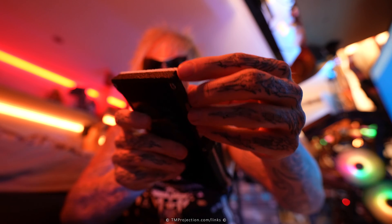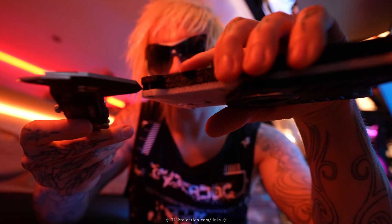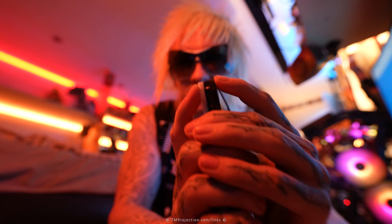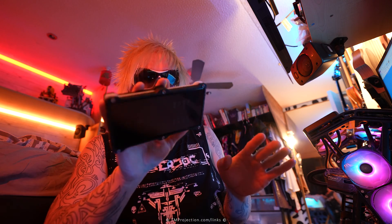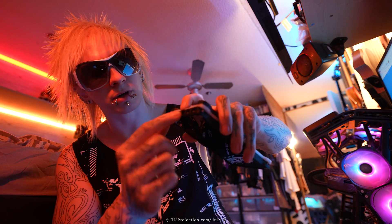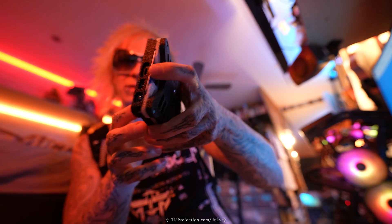The design is much stronger now because we have the corners right-angled — they are square now, 90 degrees. They're not rounded off anymore. In version one they were rounded off. I'm talking about what goes between the front and back layers — this area here. Although it doesn't sound like a big deal, it actually wasn't joining properly when printing rounded corners — the lines would skip the corners and wouldn't attach. Now that I've made them square, they are touching each other, printing one single line. I've dropped this phone quite a lot and although the phone case broke a few times, the phone is still in immaculate condition. Also, the area around the Type-C connector was really thin, but now I've made it slightly thicker, which increases strength as well.